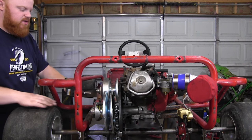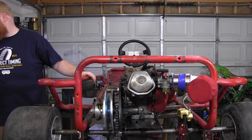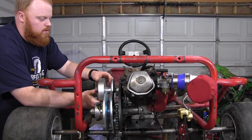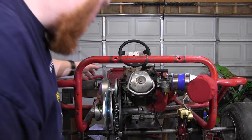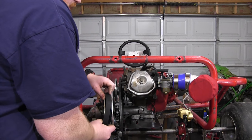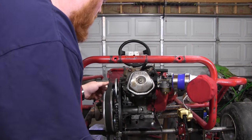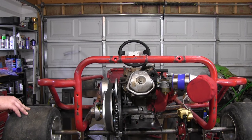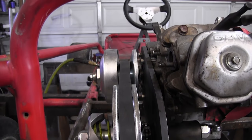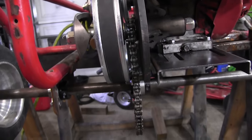We can go ahead and put this lock nut back on and pull that front pulley off to put some washers behind it. This front pulley is 5/8 by the way. I actually like that the 40 series comes with the key already made in the pulley — that's pretty nice. I'm going to eyeball this and make sure it's in line, throw the belt on — that's also a good way to tell where everything needs to sit. These 40 series torque converters, you can tell they're a lot better quality, built a lot tougher.